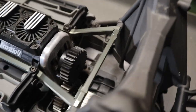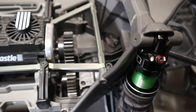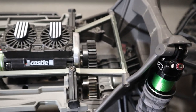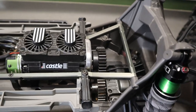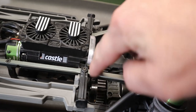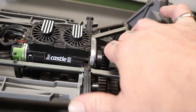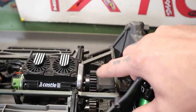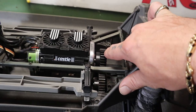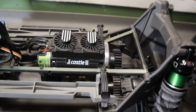and the mod 1.5 spur and pinion, and the D something, the grooving is a D shape, so it just makes it so it can't spin around. Now this one, I did have a 23. This is a 35 spur, and I did have a 23 tooth pinion. They're hard to get through the WFO website. They just always sold out. And at the time, I could only get a 23, but it wasn't enough wheel speed.